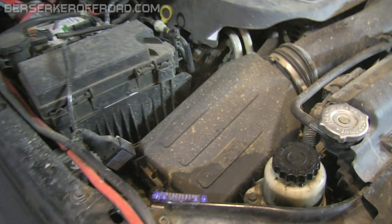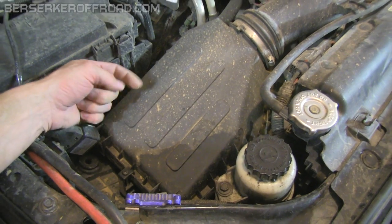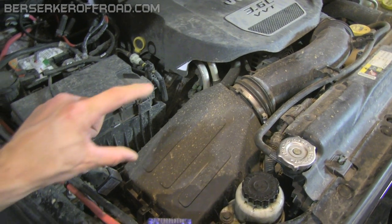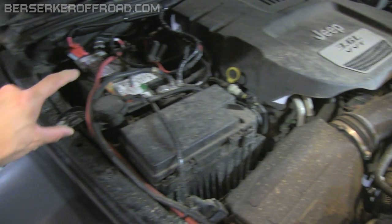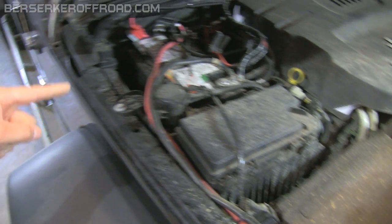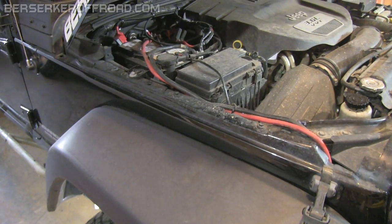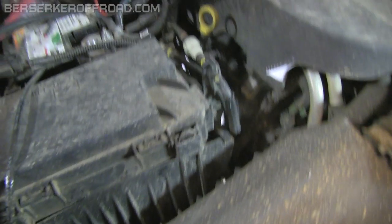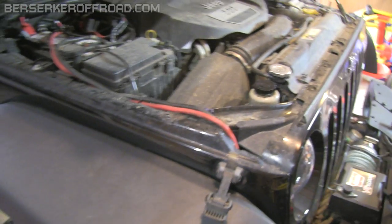Another thing: when you're putting this together, the water tightness is reliant on your ability to silicone and waterproof your own connections, and you have quite a few of those. You have one underneath the air filter box, then an elbow bracket that goes down, a connection there you have to silicone, then an aluminum L-tube that comes over — silicone that — then it goes down and up, and then a connection with a gasket to your intake. There are quite a few connections that have to be airtight so you don't suck water in. Yes, the filter is still up high, but there are a lot of places along the way that can fail and let water in. Something to consider.